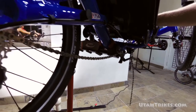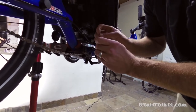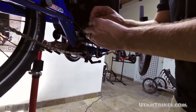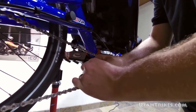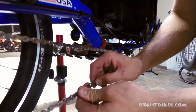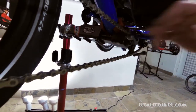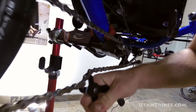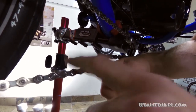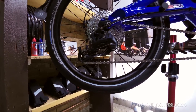Get your master link back in position. These master links are reusable, so you can disconnect and reconnect them pretty much as many times as you want. I'd say if you disconnect and reconnect more than about 10 or 15 times you might want to consider a new link, but they are very strong. Now we've got the pin seated in the slots but it's not quite seated correctly — the gap is a little too small. What I usually do is take the master link pliers, grab one half of the link, and just press down to get that link to seat. Checking our chain, we've got a little bit of a bigger gap than is perfect, but that's totally usable.